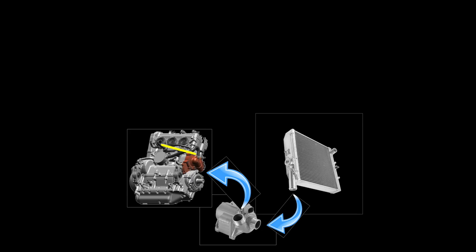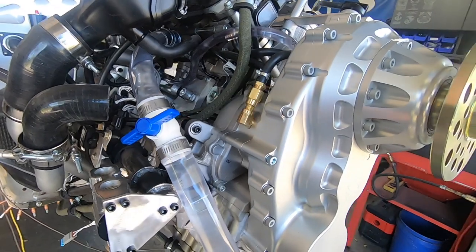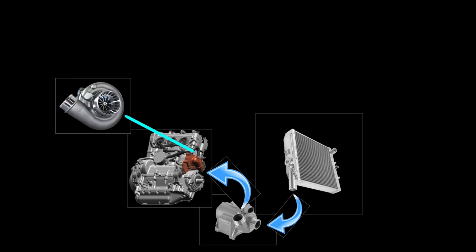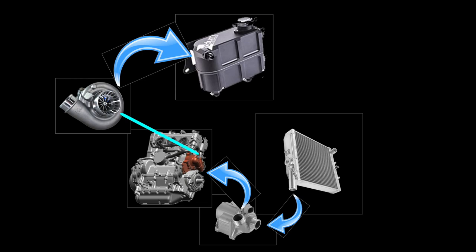The second small line is the one I mentioned in the last video that is somewhat optional. The gearbox comes with a plug in this hole on the side, but I'm going to leave that loop in place — I replaced that plug with some fittings I found locally, and I have ordered the correct barb fitting for this spot. It's routed up through the throttle bodies, and then tees into the output line from the head. The third offshoot goes back to the old water heat exchanger location, and onto the turbo — in my case it goes straight to the turbo since we removed that heat exchanger. This loop to the turbo flows all the time and isn't restricted by the thermostat. Leaving the turbo, it's up to the header tank — and this is where I'll add that heater core later, but for now I'm leaving it out.